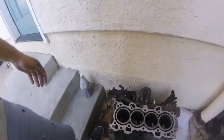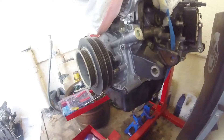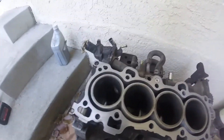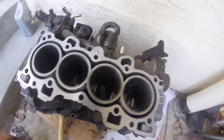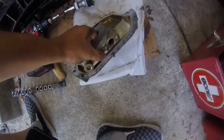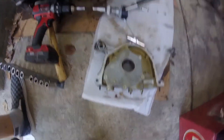Now that I know this block is good to go, within the next week or two I'll bring it to the machine shop and have it overbored 20 thousandths so I can start taking the internals from the LS VTech block and swap them over to this one. Since I found today that the rotating assembly from this GSR block is good, I might keep it or sell it — if anyone is interested, leave a comment. I also have a GSR oil pump, OBD1, that probably needs a rebuild, but if somebody wants it leave a comment. Thanks for watching.